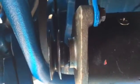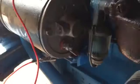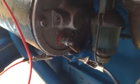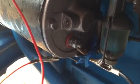Make sure you have the fan belt off before attempting this test. What we're going to do is take the other end of this cable going to the battery and touch this armature terminal on the back of the generator. When we do that, the pulley is going to start spinning.